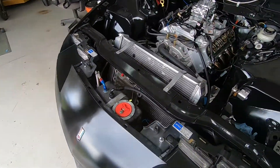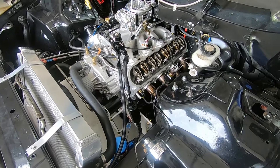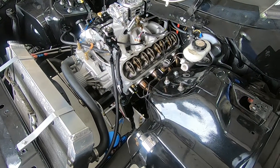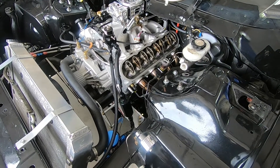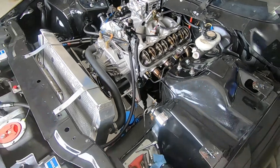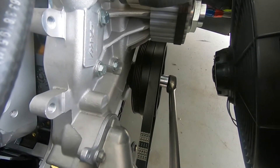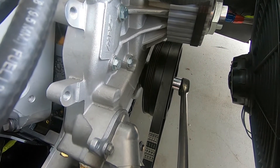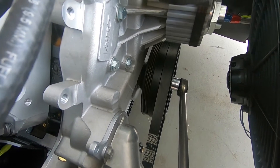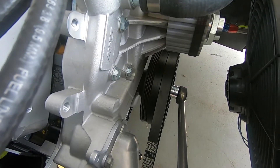I ordered a piston stop tool. I know people say you can just stick a screwdriver or socket in there, but I want something more rigid that keeps in place in the cylinder so as the piston comes up it has a positive stop instead of a socket that kind of moves around. It's on a Sunday and I do have Prime so hopefully it'll be delivered. In the meantime, we're going to work on getting a marker or indicator for top dead center on the balancer. It's a stock balancer, so we've got some work to do — we'll basically use a coat hanger for the pointer.